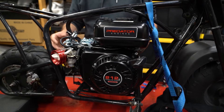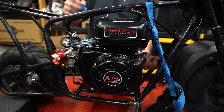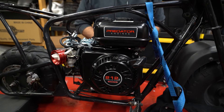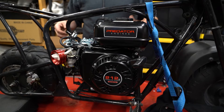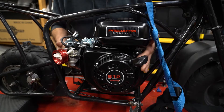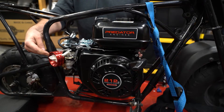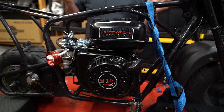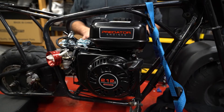She's in there. It's always kind of a pain putting these ones on just to get all the bolts to line up. If you're wondering what I was doing with the pieces of tape — the bolts facing up can tip over when I'm trying to put the engine in, so I put tape across the channel to keep them from falling over. Seemed to help a little bit. Everything is just snug — not even fully snug — just attached, because once we get the clutch and everything on there we'll have to align it. The nice thing about this plate is it gives you front-to-back and side adjustment. Now we can go ahead and get the filter installed.